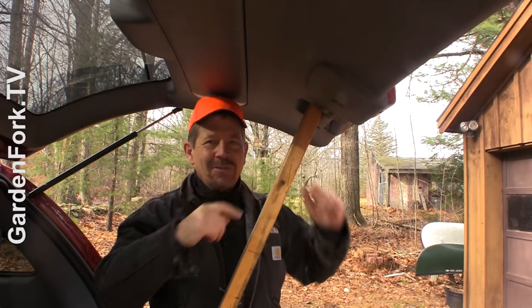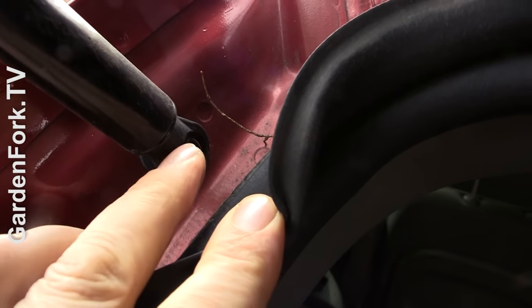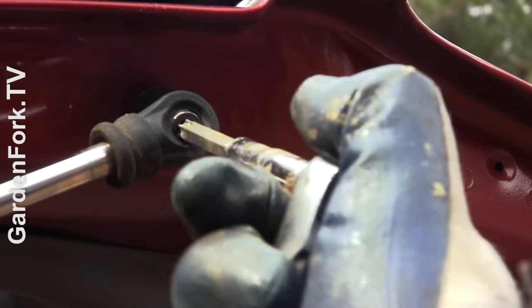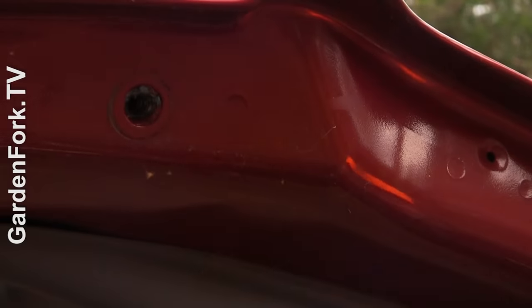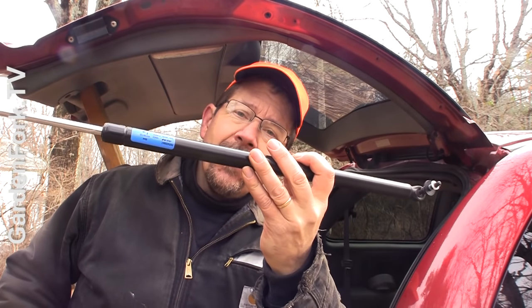Save your head — two-by-four. The screw on the tailgate is here, and then the screw on the body frame is just behind this weather stripping, right in there. Remember, you've got the two-by-four holding up that door. Just pull back this weather stripping. There we go. Nice. Old worn-out one is out.